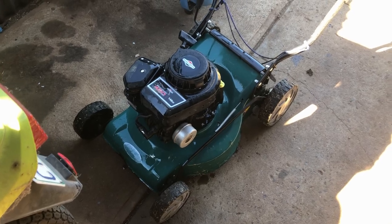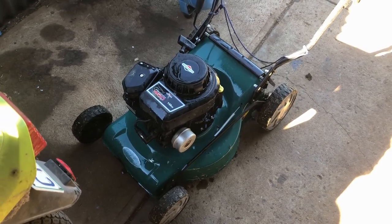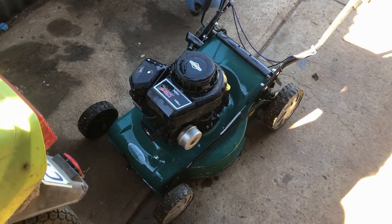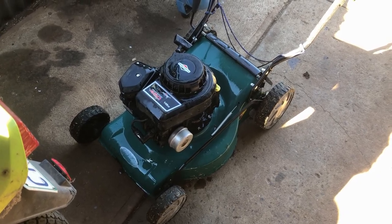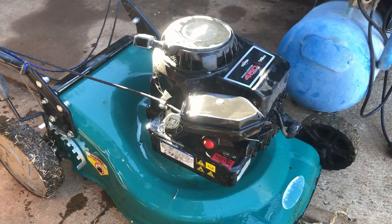So, the original complaint with this machine was it was revving up and down, then she gave it to her father, and now it just revs its guts out. And she mentioned something about replacing springs with links of wire. So, I think I already know where this is headed. So we'll just delve straight into the carburetor governor and see what it has to show us.